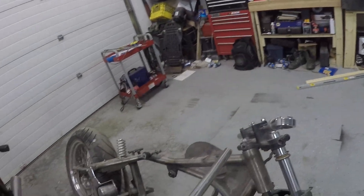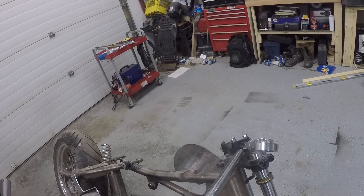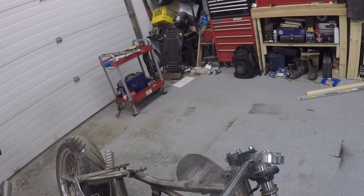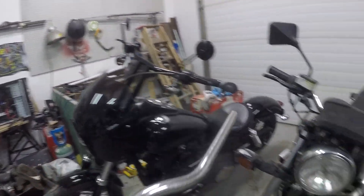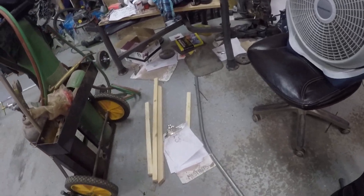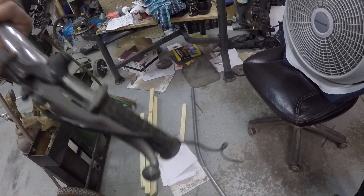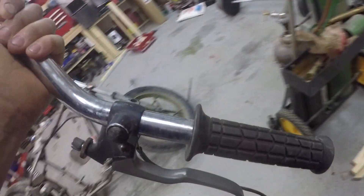It would have to be machined to fit races that would work with these particular bearings. That means smaller diameter tubes for the handlebars and a few things like that, but even that can be modified. I could drill these caps, take this out, and hone or drill this hole a little bigger so it'll take an inch pipe. I think the Harley bars are actually about an inch - if it's smaller than an inch I won't be able to put the Harley stuff on it, but this stuff I have right here might fit.